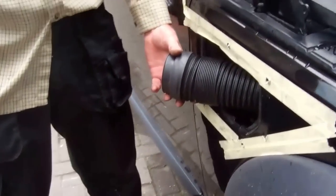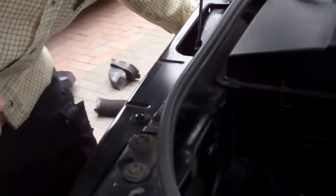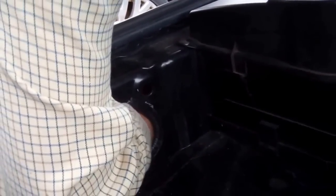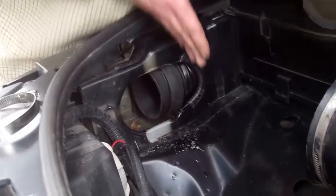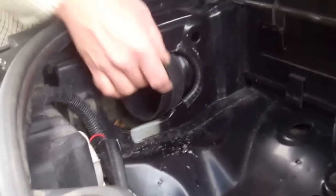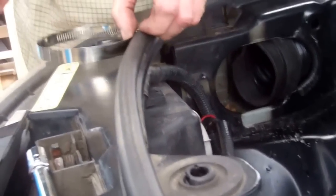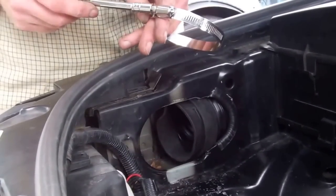Here's the elephant's trunk. A tip: if you rotate it as you're putting it in, you can induce it a bit more. I'll hold that in, then go in here — be careful with the sharp edge — and you should be able to get hold of it. Here he comes — watching the sharp edge — there we go! We did have to flatten down a little bulkhead wall in there, just to get that pipe through. A bit of butchery, but not too bad. Then put the hose clip over at an angle where you can get to the nut to tighten it.